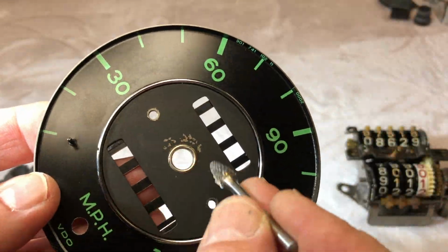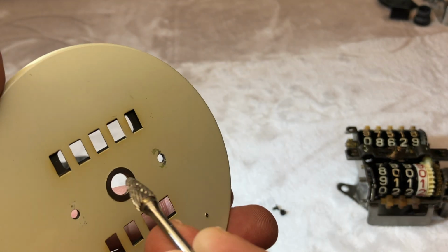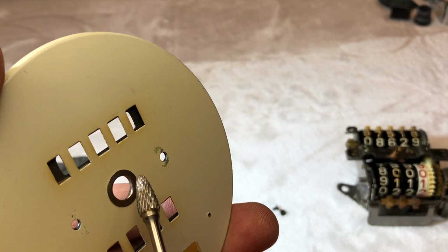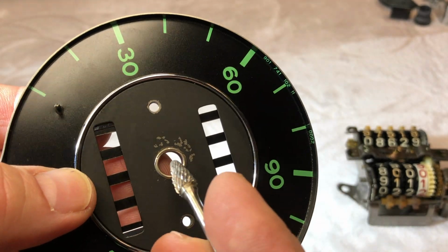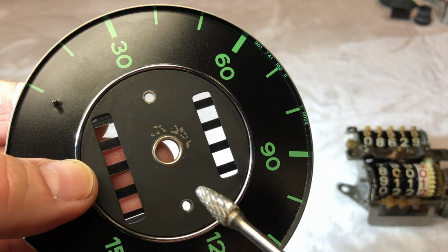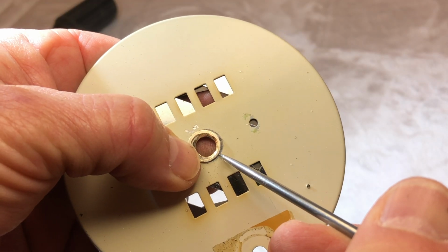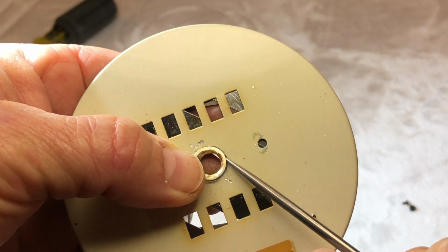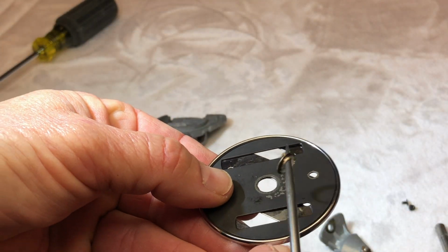Faceplate, we're going to have to get all this apart, so I'm going to do that. I'm going to take a Dremel and work this rivet here, kind of in a bevel there, very gently, until it just cuts through and releases that rivet from the front side. Once that falls out of there, then we can get all these pieces apart. Okay, that's definitely tough, but doable. Let's lift that guy out of there. It's actually like a male-female type rivet. Okay, there we go.